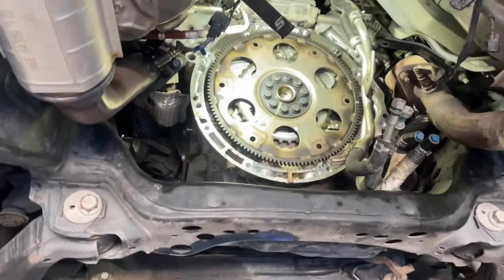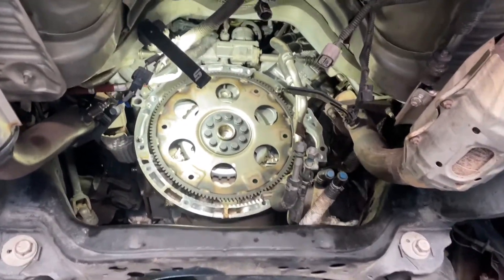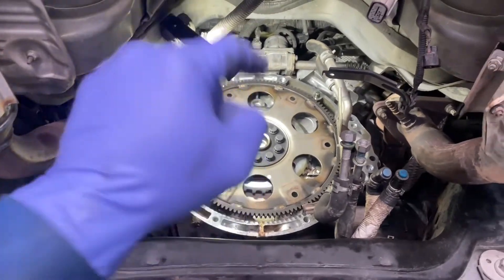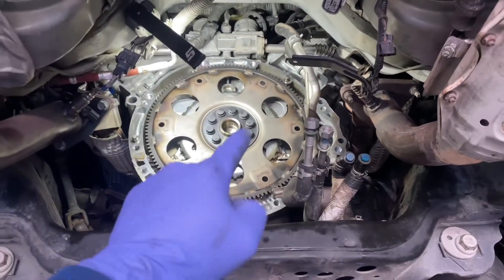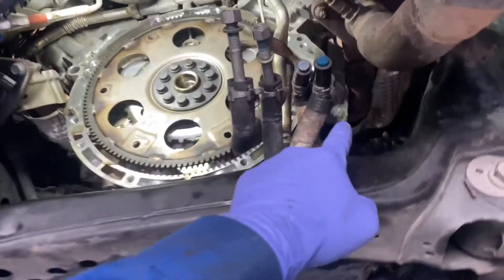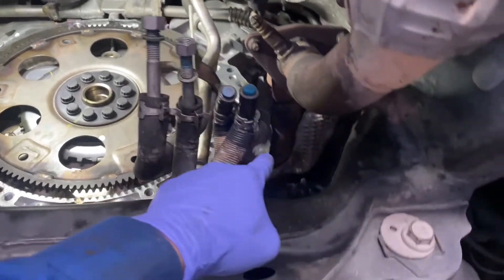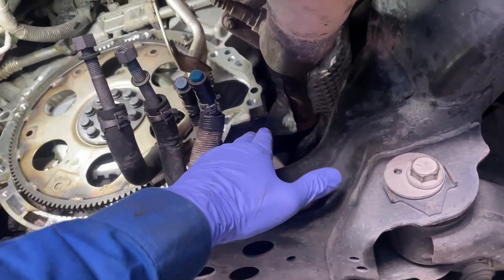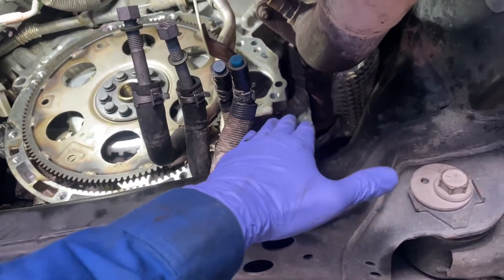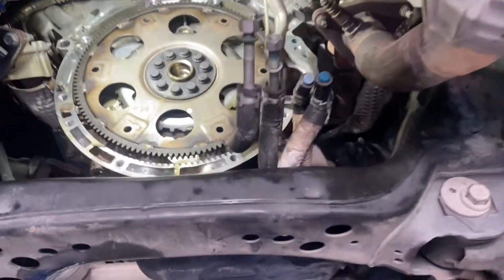The first thing, and the biggest hassle, is moving the transmission. Most of the work is going to be getting the bolts that go to the torque converter to the flywheel, because the only access hole is through the starter. The proper procedure to get the starter out involves removing the exhaust manifold, but I was able to get it out without doing so. The biggest key is to remove the heat shield first, then get the starter out — it's an angle struggle but it's doable.